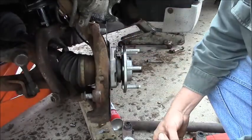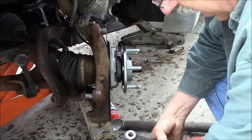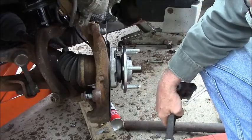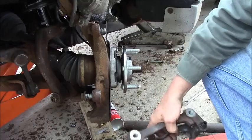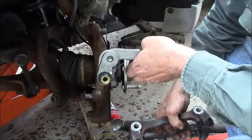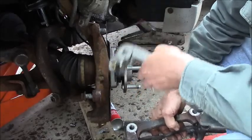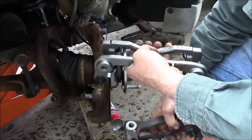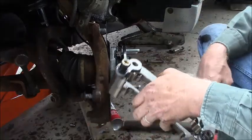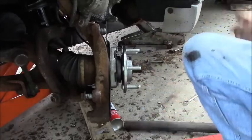So they have caliper holding brackets like this that, if you look carefully, compare the ends, hold the caliper out farther. So they're out on the rim of the bigger caliper. So when you go to get brakes for anything like that, I heard they did it with Chevy trucks, they do it with the Envoys. The larger extended versions have bigger brakes in the front, so make double sure you're getting the right brakes for the right place in the car. So, anyway, back to putting this together.